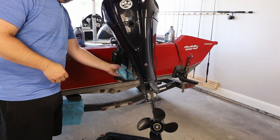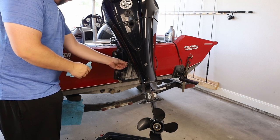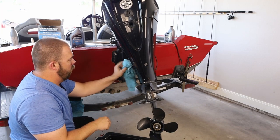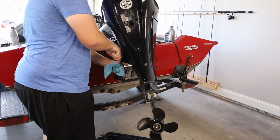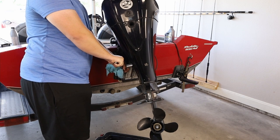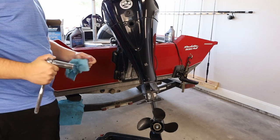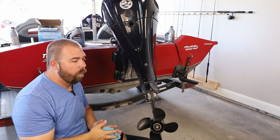We only have a slight drip now. I'm going to wipe down and clean around the drain, and then clean the plug one more time before reinstalling. Get the ratchet and socket and start tightening the plug down. You do not want to over-tighten, but you do not want to under-tighten either — one good snug fit should be fine, and it shouldn't leak especially with a new gasket. Now it's time to put the motor back down and work on the oil filter, then refill the engine with oil.